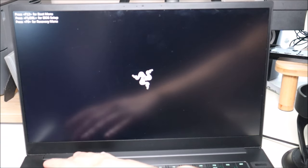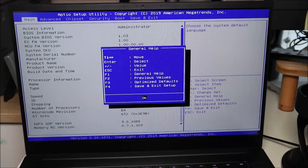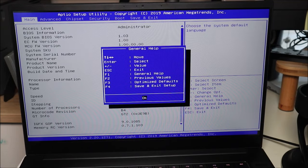I'm going to hit power and then start tapping on F1 right away. And there's your Razer BIOS. Hopefully you guys have a general help key like I do — it shows I'm going to use my arrow keys to move, Enter to select, and plus and minus keys to change values. Some of you may need other keys; your Tab key may move you around, and some of you may have use of your mouse in BIOS. If you can't figure out how to move around, try an external mouse or keyboard that plugs into your USB port — sometimes that will allow you to navigate BIOS.